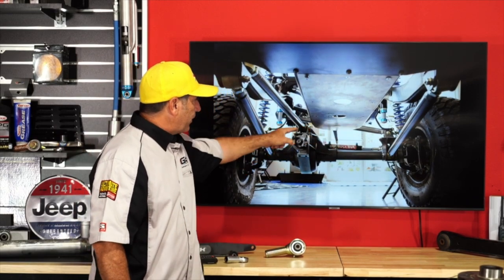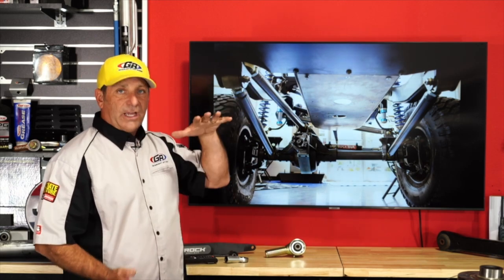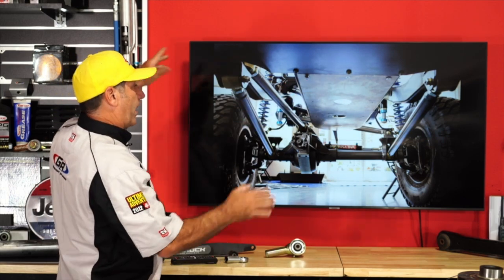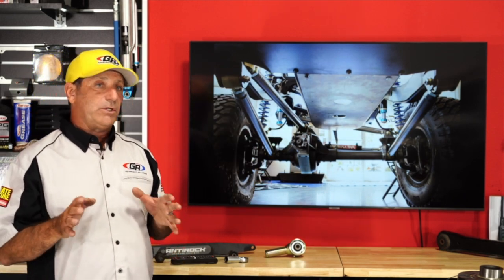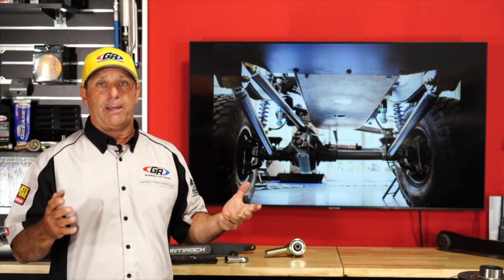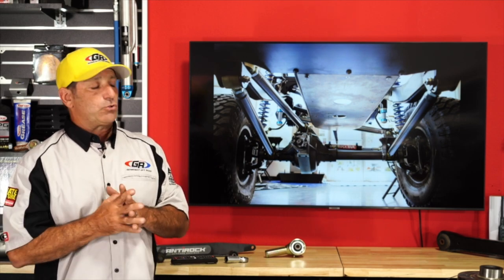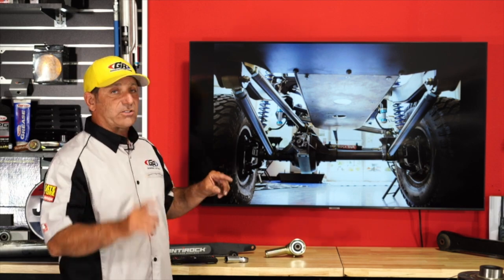With a builder's kit, you've got to cycle the whole suspension — take the springs off and let it move. Make sure the skid plate edge isn't getting into the differential, the drive shaft isn't rubbing through its cycle, and cycle it left and right turning the wheels. We typically make mockup links — some people even use PVC pipe — to try this and make sure you're getting the most out of it before building your final links. The DIY kit gives you a ton of flexibility; it's 100% up to you to make sure everything clears.